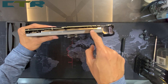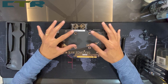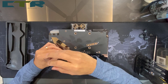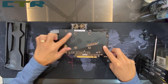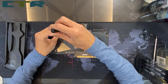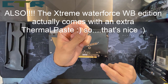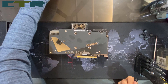When removing the screws, I'd like to remove the screws for the die last, because these screws here hold the front water block as well. Good thing about this card — there's no tampering sticker, so I think they really did build this card for people who'd like to tear it down. Take note of where you put your screws — you don't want to mix and match them, so make sure they're organized.